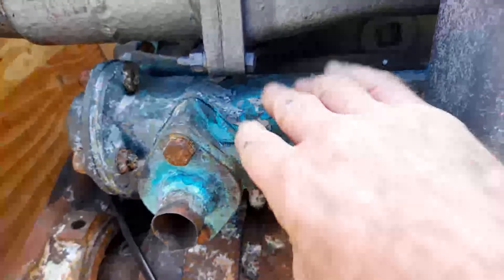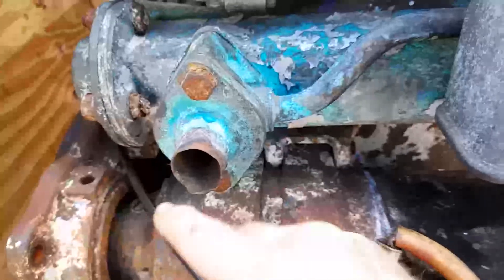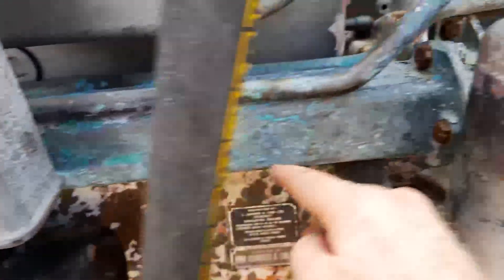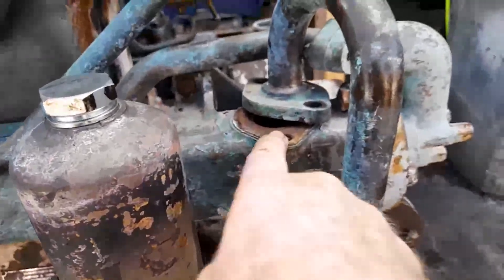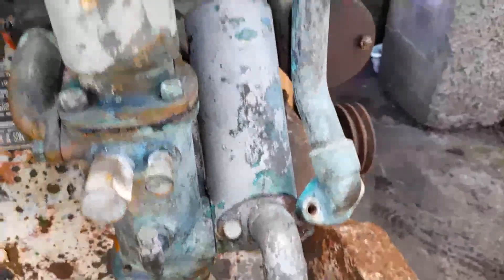The pump in effect reduces the pressure inside the oil cooler, so water is sucked in through this port here, along the oil cooler, right along the oil cooler and out through this port here, up through that pipe, down through the pipe and back into the pump.